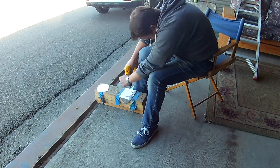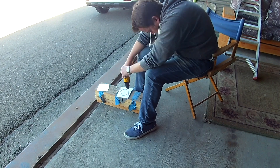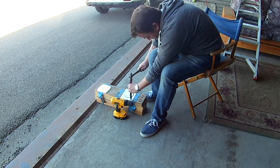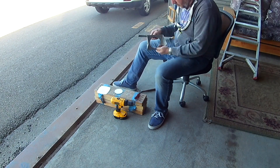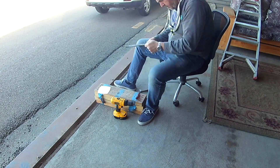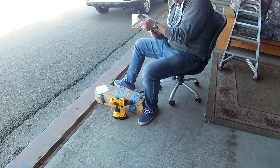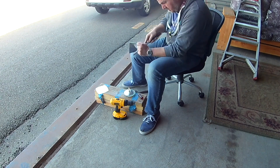The bracket inside the wing itself has a big hole — glaringly obvious, that's where the light goes. That bracket has flanges on the side with nut plates, so on the side of the bracket you see me making here there's going to be a slot cut. It needs to be at least three-sixteenths inch wide — I usually did 1/32 over that or 1/16. That's where the AN bolt and lock washers go. The inner wing bracket is like five and five-eighths or five and three-eighths — you need to make these about a total of one-eighth inch wider.